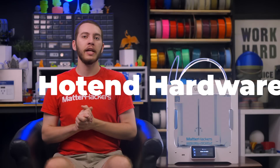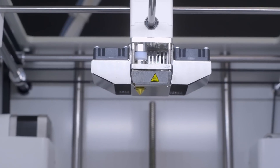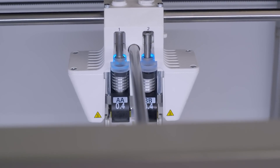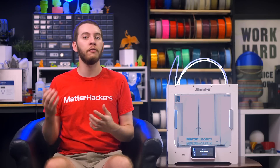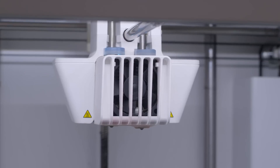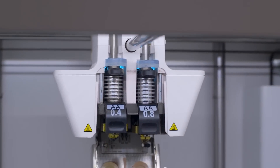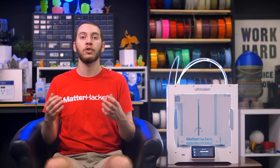What really sets the Ultimaker S3 and Ultimaker S5 apart from other 3D printers is how they incorporate their hotend components. Where the Ultimaker 2 Plus Connect has the heat sink, heat break, heater block, and nozzle all rigidly mounted to the printhead, the S3 and S5 use print cores. These are components that feature everything needed to make a hotend in one easily removable package, so you can swap out the entire print core if you want a new nozzle size, new nozzle material, or if you want to remove it for regular maintenance. Simply follow the wizard to remove material, lower the fan bracket, pinch and remove a core, insert the new one, and get ready for printing. And because each print core has a built-in PCB, the Ultimaker will remember the offsets for the nozzle's position, so you don't need to completely recalibrate the printer after swapping print cores.